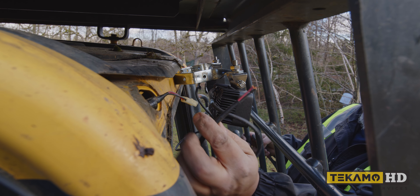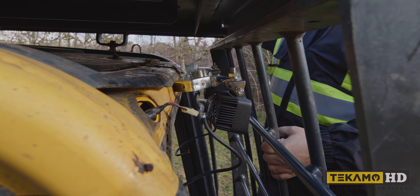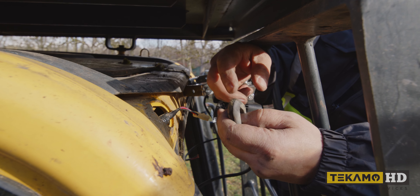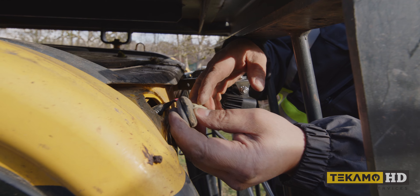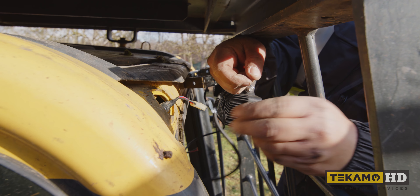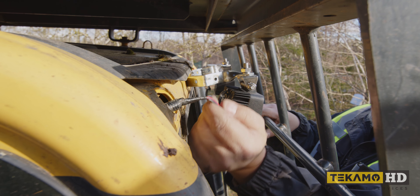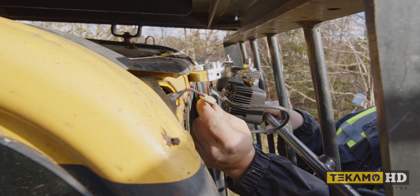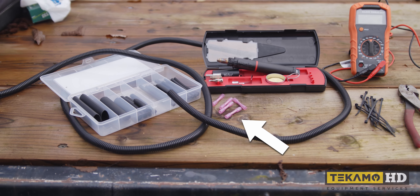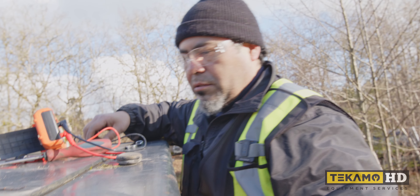There's plenty of wire here. We're going to use the same grommets that were on there before — that way we don't get water in there. We're going to put some silicone, make a little hole right down the middle just so this wire goes in. The rest we're just going to cut and let it sit inside the cab behind this grommet, and we'll just seal it with a little bit of lubricant. We need to cut these and connect them with straight butt connectors which are sealed, to prevent any moisture getting in. We'll need our cutters and all the other equipment — can't forget the grommets.